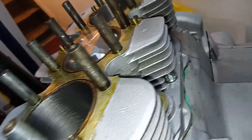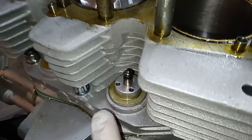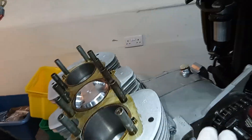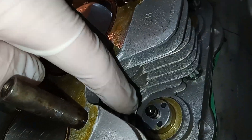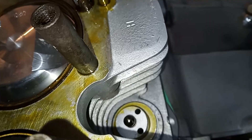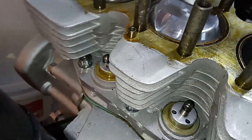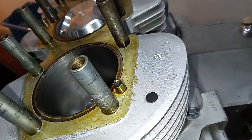One very important thing: I've also used my paintbrush to put well seal around the bottom of all the tappet blocks, ready for when I fit the push rod tubes later on. When the head's on, it's quite difficult to get to the back of these tappet blocks even with a paintbrush, because the head comes over and it's hard. So I've remembered to do that before fitting the head — it's just easier.